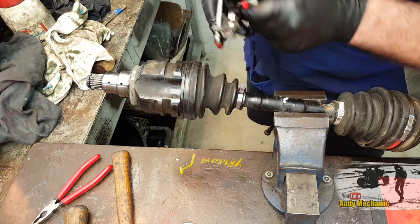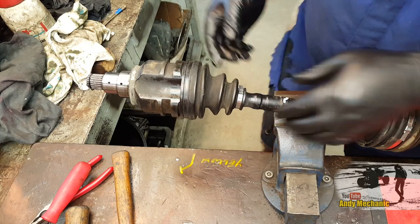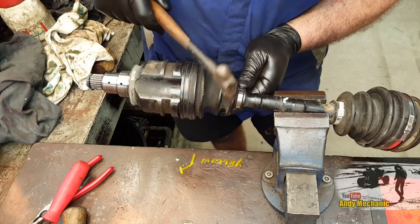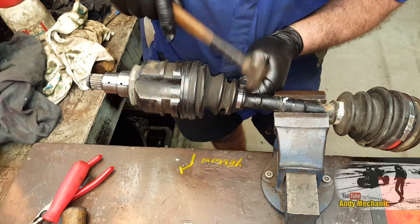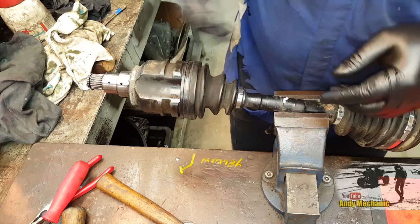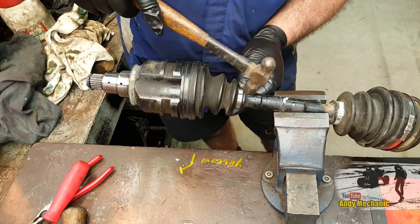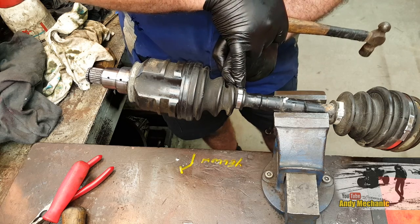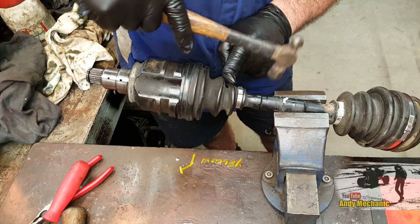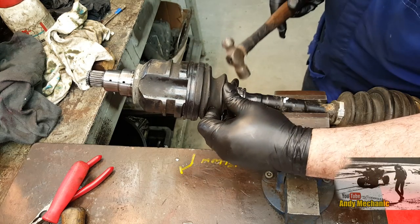Perfect. And then get rid of your tool, bend that flat. Do it pretty quick. You don't want to leave it hanging because it might slip back. And then just flatten it off. That's going to give it a nice 180 degree turn. So there's no way it's going to lose tension now. And this little tail is just held down by these two little tiny tangs on here, which you can just hammer over with your little hammer. You see, I knew it had a job.